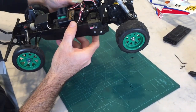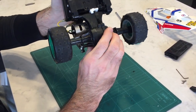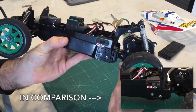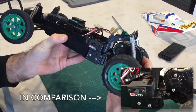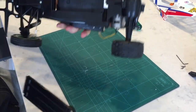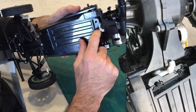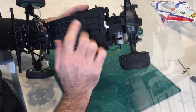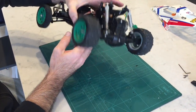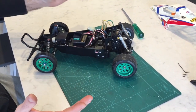The car is all back together — that's the brace there. As you can see it still allows that articulation side to side and normal suspension movement. There's no up-and-down gearbox slap like you'd normally find with the Grasshopper and other hopper vehicles. I would actually think this is an awesome upgrade, and ANPRO Engineering have ensured all clearances are maintained so nothing interferes with the back battery door.